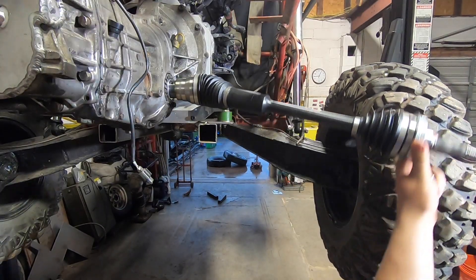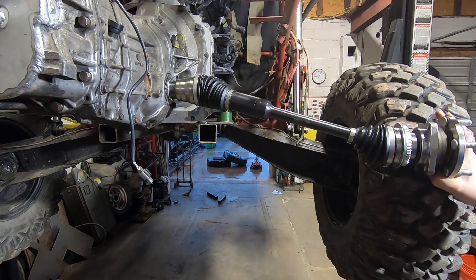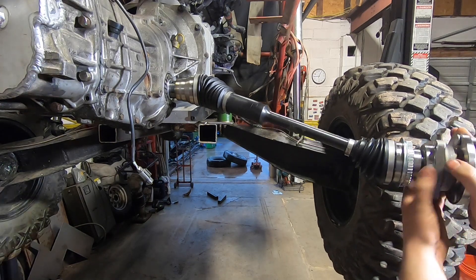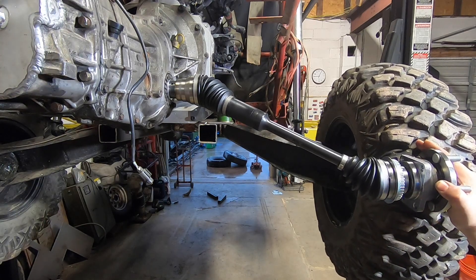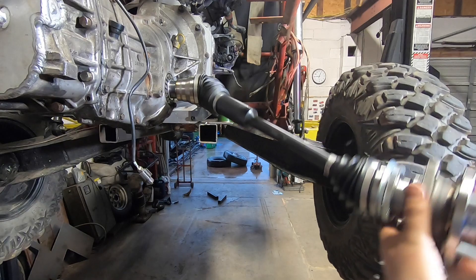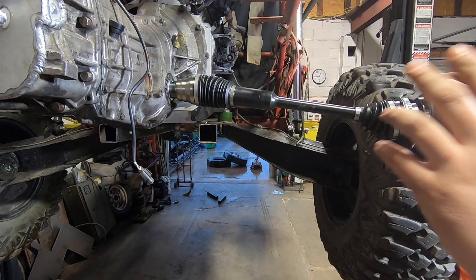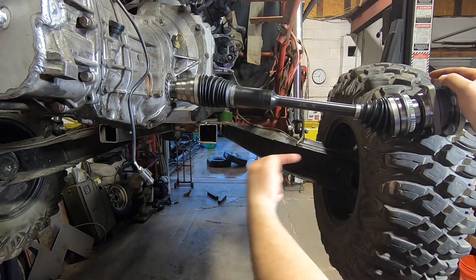Hopefully this 2010 Subaru wheel bearing fits right on an older Subaru Outback axle. Looking at axle length here — I thought the axles were going to be too long, but they're actually going to be too short to keep my target track width. So we're going to have to play with that — maybe a wheel spacer, maybe extend the axle. Being that these can operate at such extreme angles, we're really flexible in what we can do with our axle arrangement. And if you remember from previous episodes, my axle centerline is pretty far back from the centerline of the actual tires.